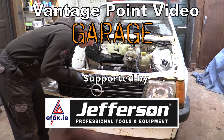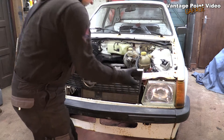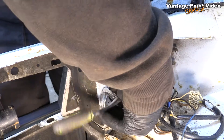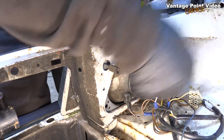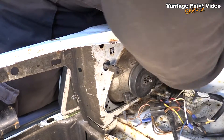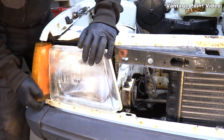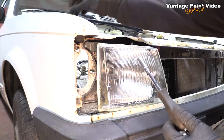I'm going to remove the wiring and basically anything electrical in the car. I'll just take out the grill so I can get easier access to the lights. There's just three screws that hold them on — one goes in from the back. While I'm there I'll disconnect the bulbs. That's the dip and main beam, and that's the parking lights. Indicator — that has to come out first. Then you get access to the two screws that go in from the front.